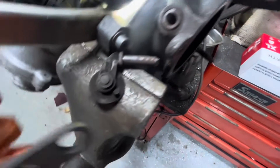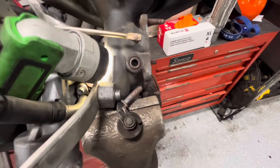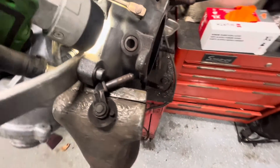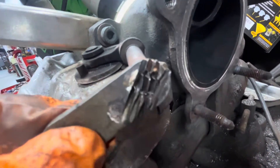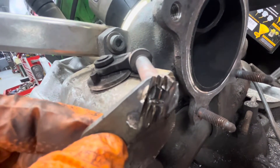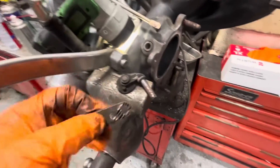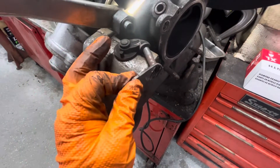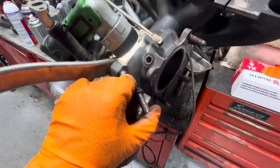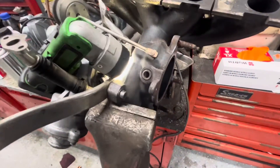I'm going to get one of those kits now and replace the bushing, replace this little valve, push the new arm into place, make sure everything is positioned correctly, and then tack weld it into position. I cut it with a cutoff wheel so I can pay attention to the grooves when reinstalling — not that it'll make much difference, since you're not going to be able to really get it in the same position anyway. You're just going to end up putting this thing together, positioning everything the best you can, and tacking it into place.